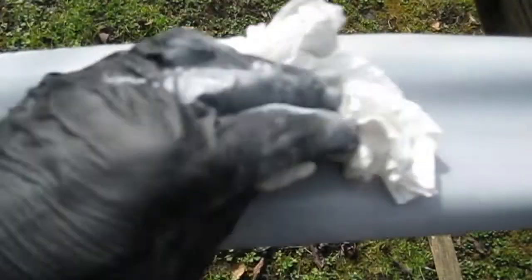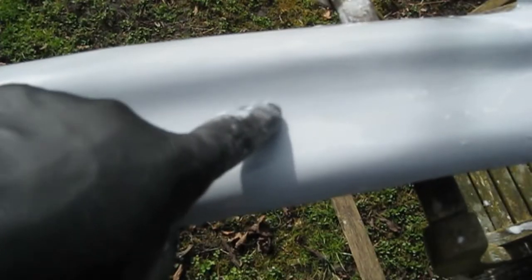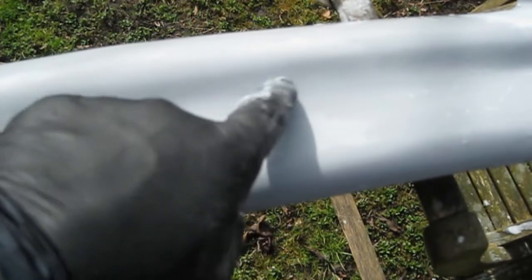So what I'll do is I'll probably do a guide coat of silver first and then just check how it looks and how it's laying down. And if I do, I've seen little pinholes and things, little marks like that one there. I can either put a little bit of stopper in it. You see them scratch marks, and if you can see those on camera, there's some little scratch marks and prep lines in there, so let's see if I can get those out as well.